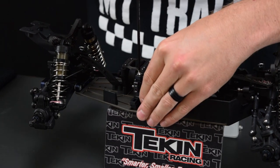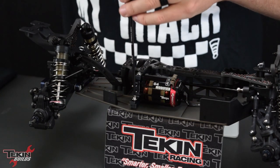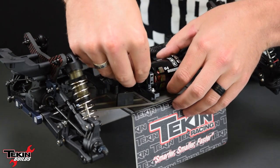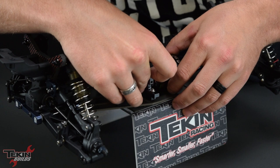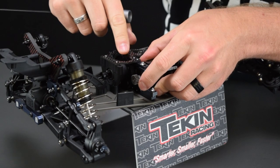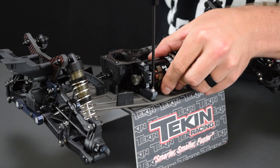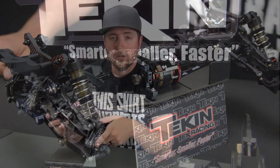I've got these really cool brushless motor screws from Lunsford — they are titanium and have a kind of shoulder washer built into the head, which will work perfectly for holding our motor mount. Now we're going to throw our pinion gear on — I'm going to go with a 20-tooth for this motor and run the ESC in spec mode with no timing, leaving the stock 30 degrees on the end bell. Then we want to set our gear mesh, checking it in three or four different spots around the spur gear to make sure there aren't any tight spots, since spur gears are never perfectly round. So the Gen 4 is now in our car with our 20-tooth pinion on and gear mesh set.